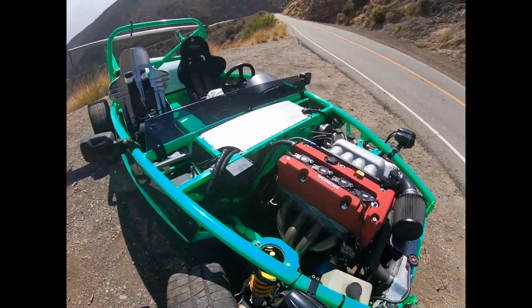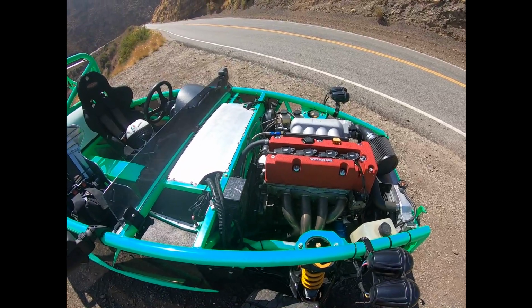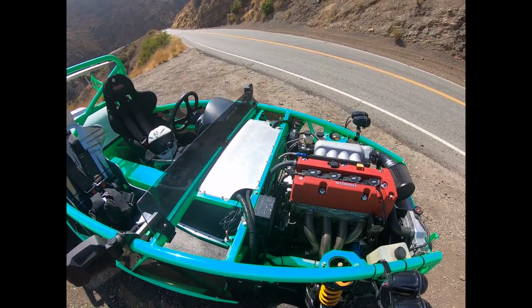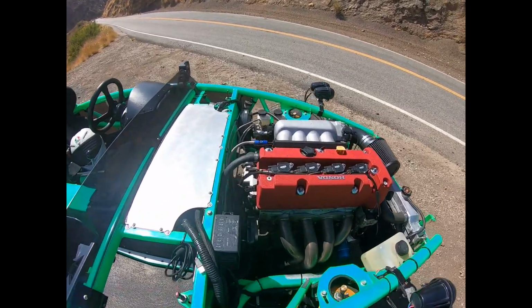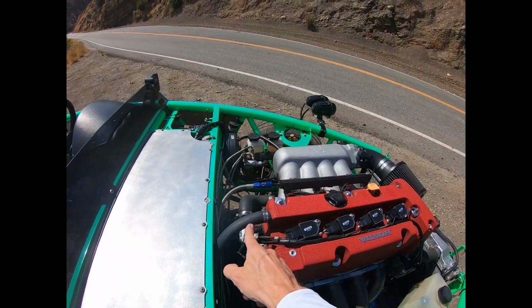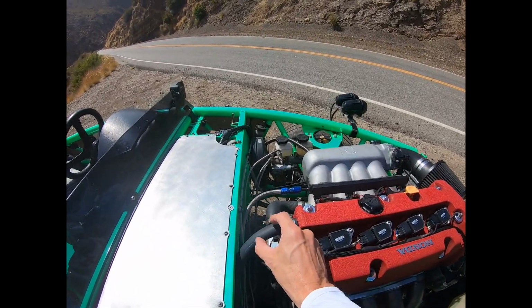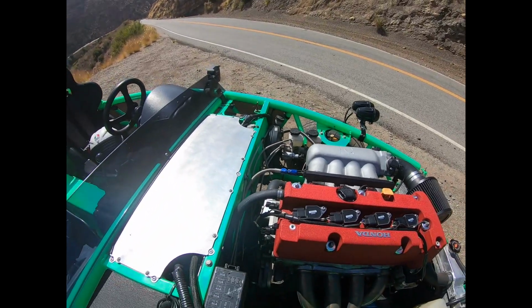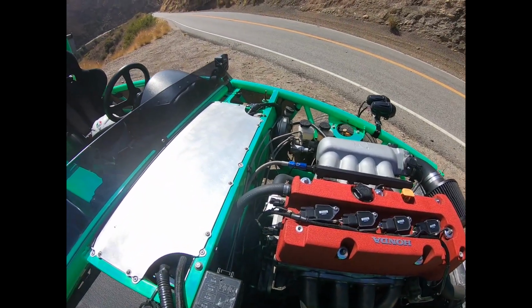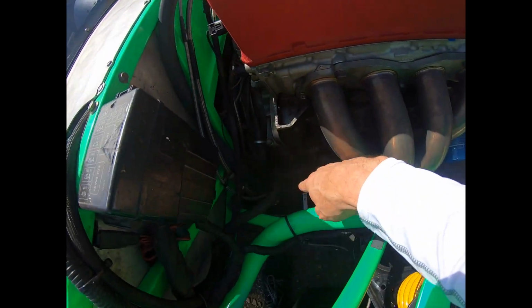So next thing, for a few years now I thought I had an exhaust problem being pulled forward, and I couldn't seem to get rid of it, and I couldn't figure out why. Well, turns out the exhaust coming out of the valve cover breather was actually just here in a little filter, and it was getting into the cabin, and I could actually smell that. And now it's down by a hose and down to this filter at the bottom, so I don't have to smell it.